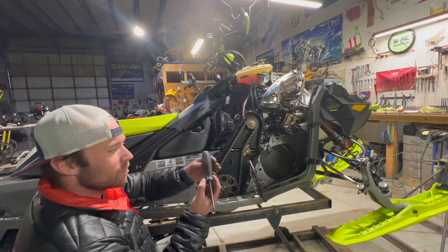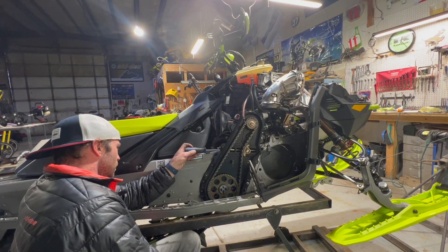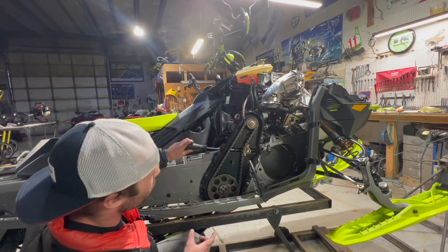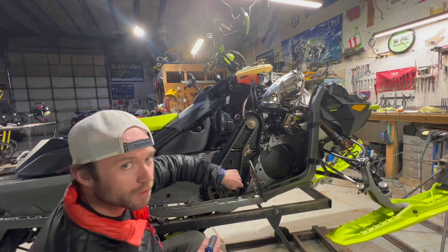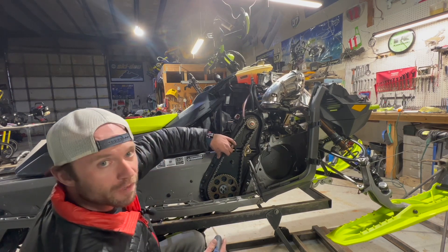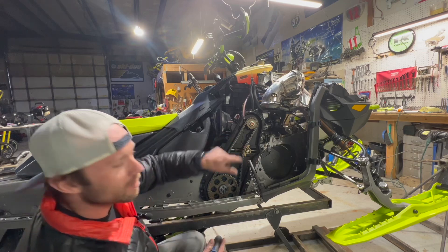I have a T25, a little screwdriver type. I'm just going to back it off two or three turns — so that's three turns. As you can see, the chain is now trying to loop around the bottom of the sprocket and that's really loose. That's maybe two and a half turns — it's enough slack that it's going to make contact with the case.